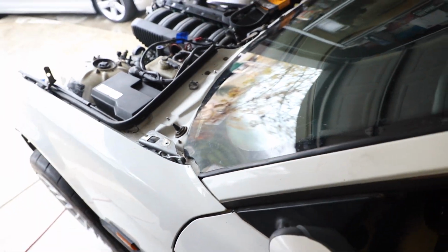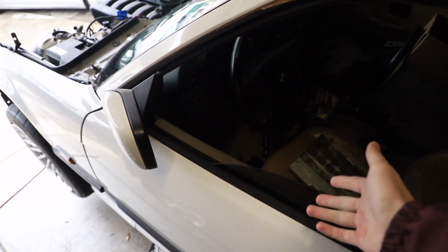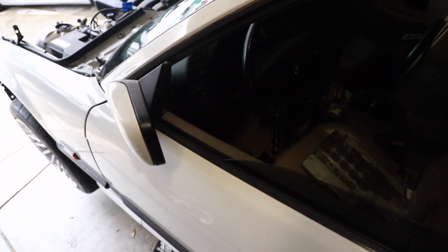So I went to hook everything up, and I realized there's going to be no way to connect it to the master without having that nipple piece. So I ordered the little elbow for the master, and when that came in, I realized that there are 2 different styles of master cylinders, and the elbow that I ordered was not the right one. The masters are just different, which is awesome. So I had ordered that, it was wrong, and I have now ordered an entirely new master cylinder, because I do not want to run into another problem.